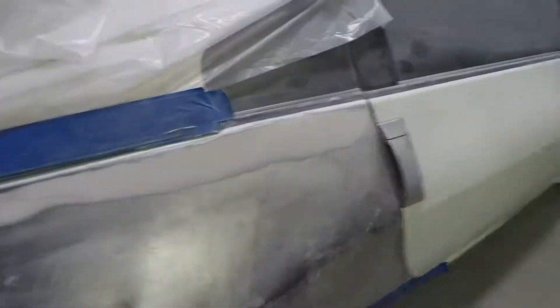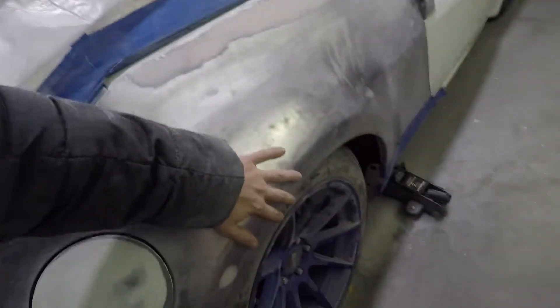I do think I'm going to have to go ahead and do the fiberglass and epoxy repair because I don't have my welder right now - it actually broke, so I've got to get a new one. There's always another solution to something. So we're going to go ahead and head on to Walmart, get some fiberglass repair for the body, get some epoxy, come back over here, put it on, and then lay another coat of primer, and hopefully it'll be good.